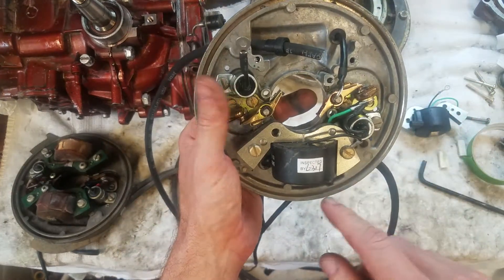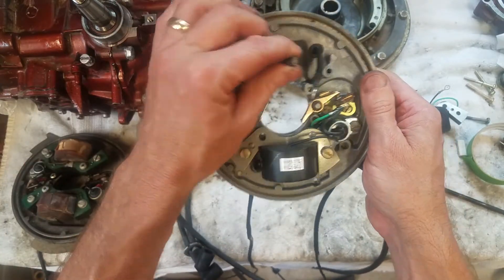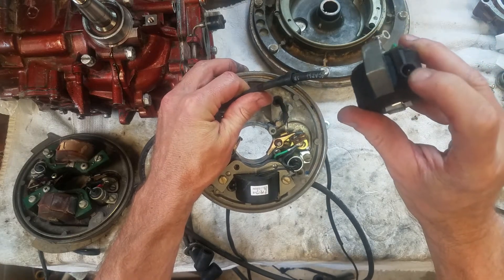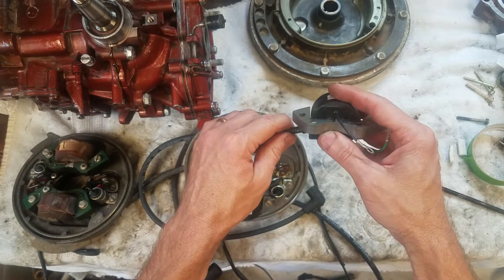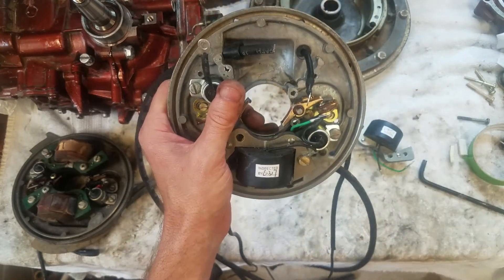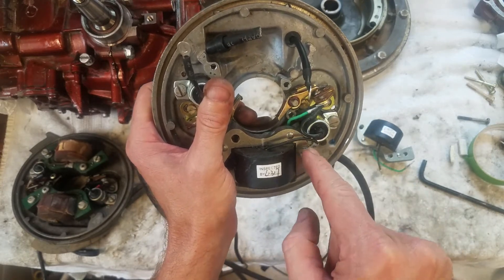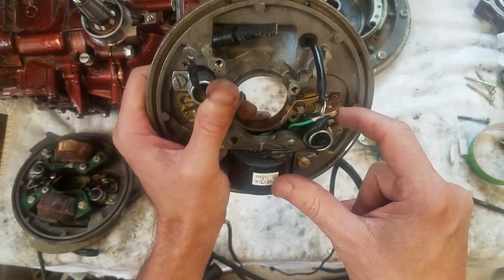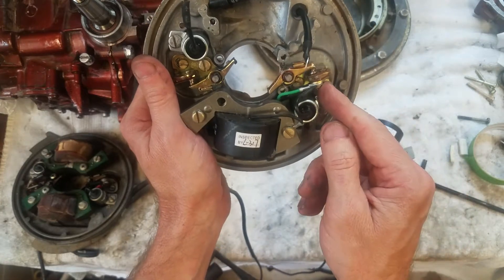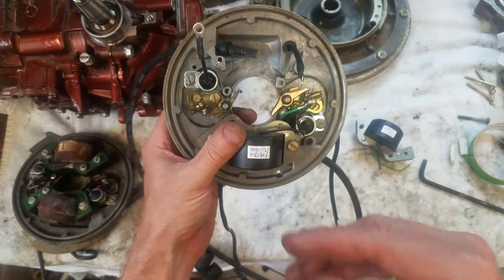The plug wire comes in from the bottom of this one, same as it does for the one on top. When you get a plug wire, it's going to look like this. You get another coil, and the coil will have an end that receives the wire — it's as simple as just shoving one into the other until it seats, then you bolt it down. The coil has to have a ground, so this is the ground wire for the coil. Then its field wire goes to the points. The condenser's wire goes to the points. The kill wire goes to the points — so you have three wires going to the points, and the coil is grounded to the body.